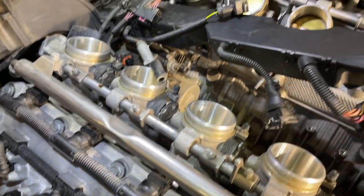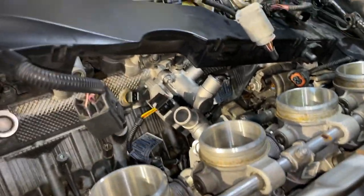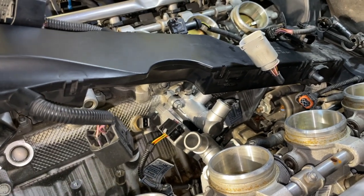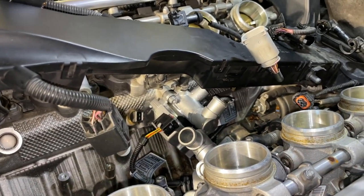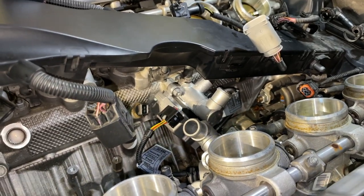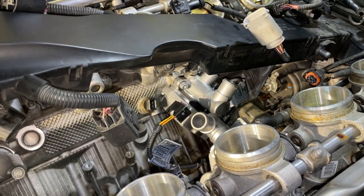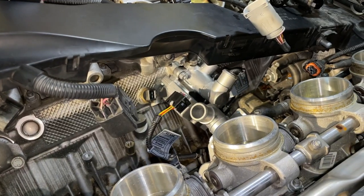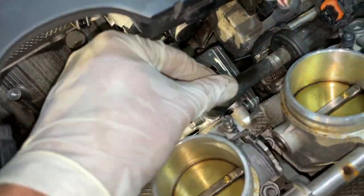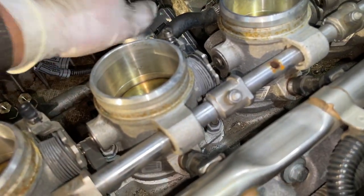With idle actuators installed, lubricate the o-rings on the pipes that go into the cylinder heads with a silicone-based lubricant so they slide in more easily without compromising the o-rings. Don't forget the black metal spring ribbon pieces — they only fit one way. Use new nuts torqued to 10 Newton-meters — about 89 inch-pounds. Then place the hoses back on top and tighten down the 5mm hose clamps. Make sure electrical connectors are free and not pinched; they'll be connected later.